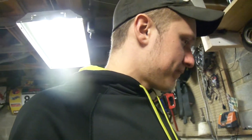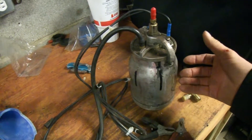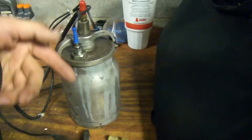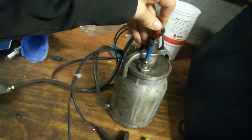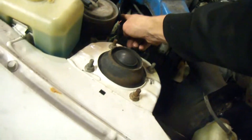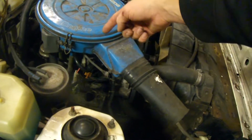I'm going to show you this ingenious thing we call a smoker. Basically it's a paint can full of baby oil with a sock in it and some nuts and bolts to help keep that in. This right here is a diesel pickup truck glow plug that goes down into the baby oil. When you shoot it up with 12 volts it boils the oil. To get the smoke out, you take a standard issue grill pressure regulator, plug that into your air chuck, and hook the red cover up to some sort of vacuum line. In my case I'm going to tape off the hole and hook it up to the bottom of the air cleaner so it pumps smoke down into the carburetor. Then I'll be able to see if there's any vacuum leaks between the carburetor and the engine.